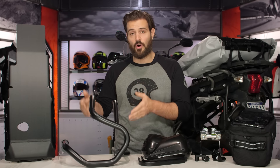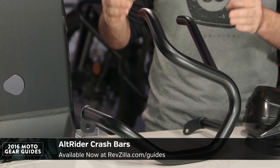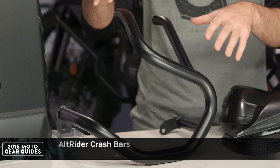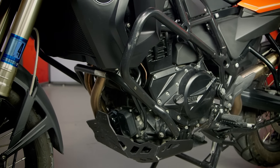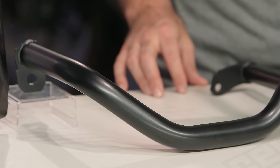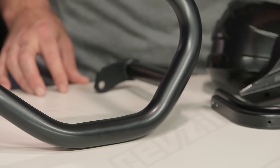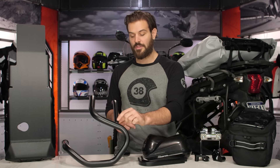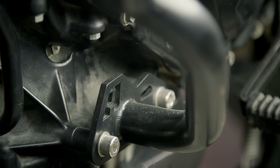That takes us right into the Alt-Rider crash bars. They make a really nice union together because they're optimized so you can use them together and get the pieces that best integrate both the crash protection and the skid plate protection. These are off a BMW R1200GS — pretty much the grand mac daddy of off-road ADV bikes. You're going to see massive 1.25-inch tubing and they use stainless steel. Even though they powder coat it, if you crash and scratch that powder coating off, stainless steel is more impervious to the elements so you don't have to worry about it rusting. They also use a five-axis point with a 360-degree weld for the strongest weld and protection on the market.